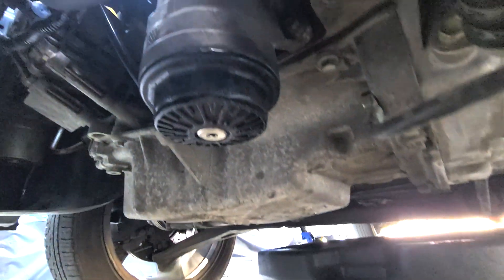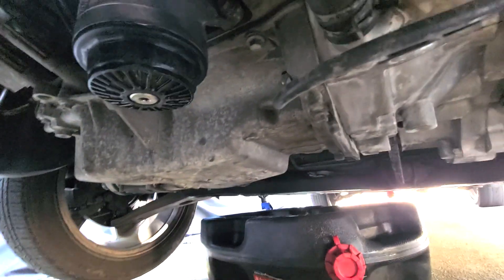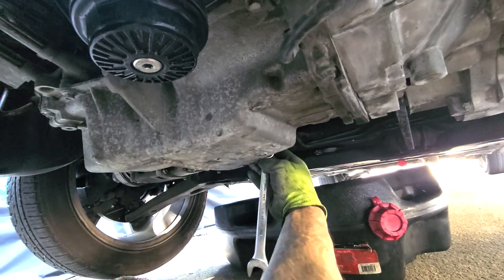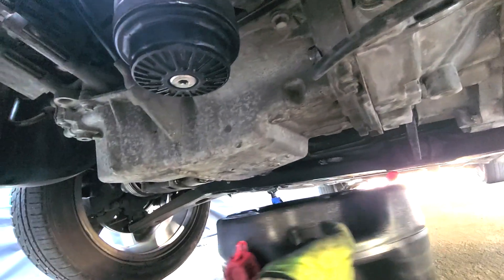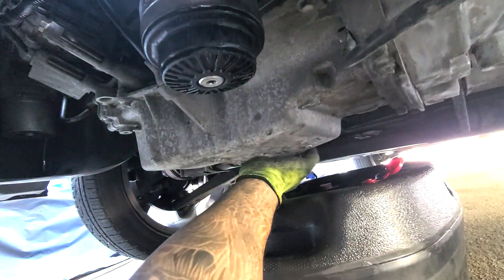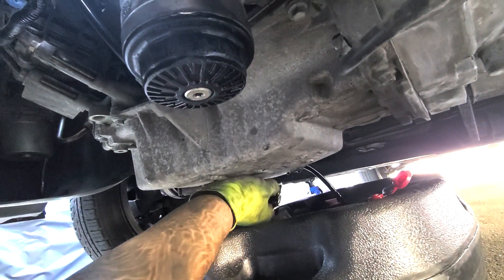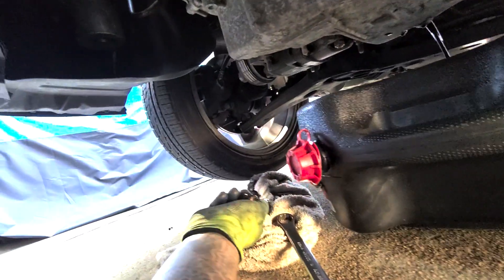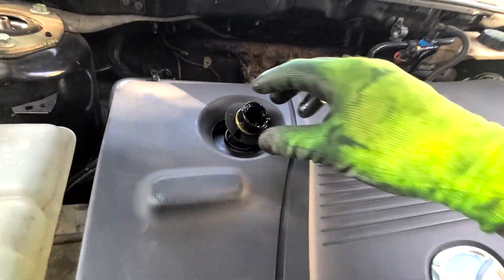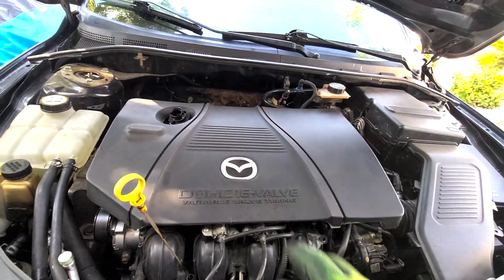Get your wrench. I cracked it for you with the wrench — I'm going to undo it by hand. Have your oil catch ready. I like to angle the bolt kind of vertical because it shoots out that way. Go ahead and loosen it up, hold onto the bolt, and let that fluid flow. Let her drain out. Have a towel nearby. Wipe your hand. Make sure the oil cap on top is open so it can breathe. Maybe pull the dipstick too. Let her drain for about 10 minutes.